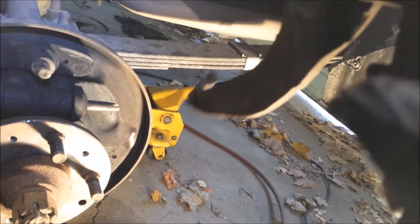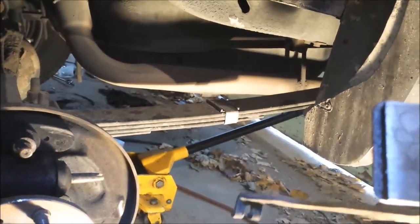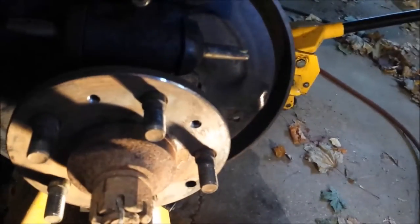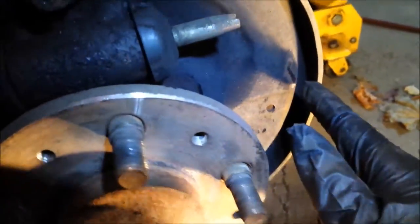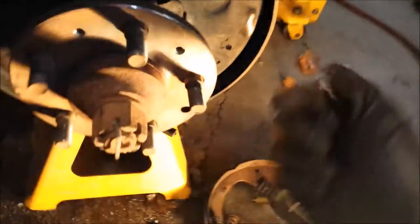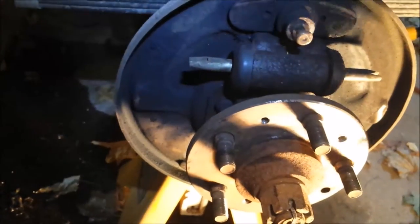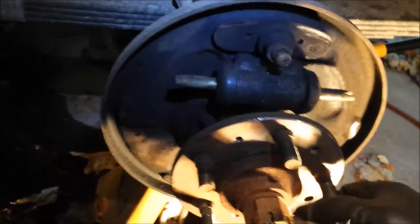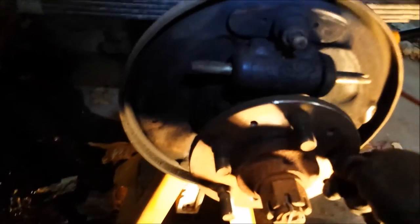These drums may have got a little bit of life left. I thought these things would be more worn out, to be honest — I thought I heard them rubbing. But I guess they're alright still. I also want you to take a look at your backing plate — you can see where the shoes are rubbing. What you want to do is take a little wire grinder, grind those out and clean them up a bit, and then put a little bit of anti-seize or some kind of high-temperature lubricant — something that would survive in a brake area — and just clean that all up.